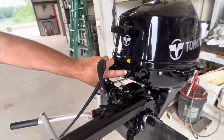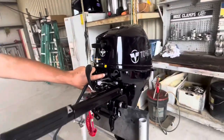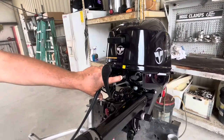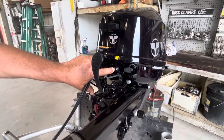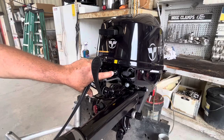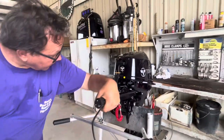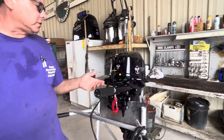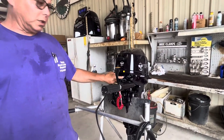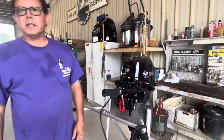This right here is an oil pressure light — all of this is also in the owner's manual. The light will illuminate three to five seconds, meaning there's not enough oil pressure present, then the light goes out. Obviously when you're driving the boat you're not going to be looking back here. So if it sounds funny, makes a weird noise, rattles a little bit — turn around. If the light's illuminated, turn the engine off, pull the cover off, check the engine oil.